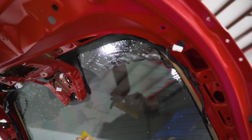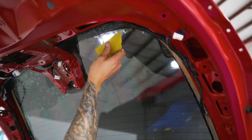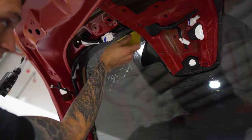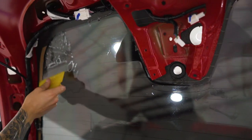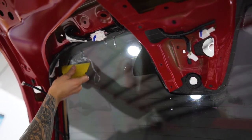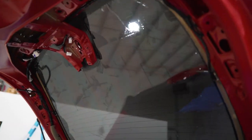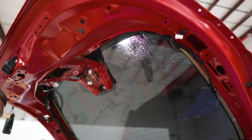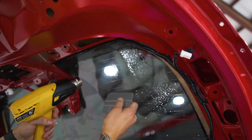I like to go straight up because you will have some fingers that need to be touched up. That is totally fine — just attack those quickly. Get this side squeegeed up. You can see why I cut this out completely straight, because even on this side it gets kind of annoying — you can end up grabbing it with the squeegee and ripping the film. Then do a final shrink on these bottom pieces: a little spritz, a little heat, a little push, and done.